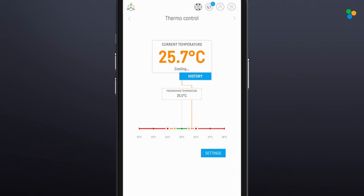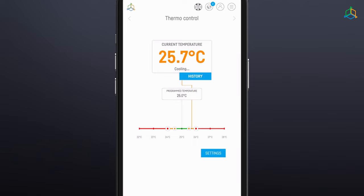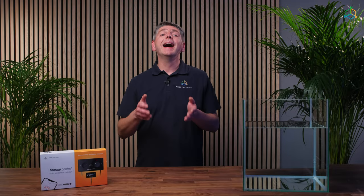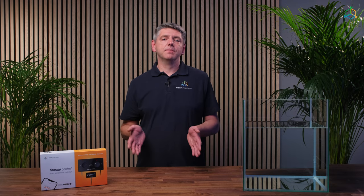After calibration, ThermoControl will display the adjusted temperature value. When you press the set button again, you will see the difference values measured after the calibration process. If a value appears, it means the temperature value you entered is 0.8 degrees higher than the value measured before calibration. Remember to put the temperature sensor back securely so that it cannot become displaced.